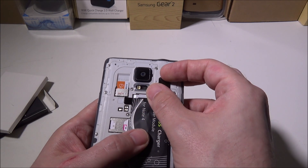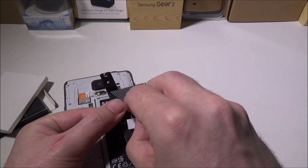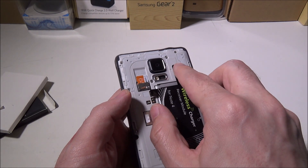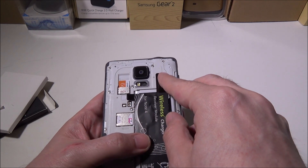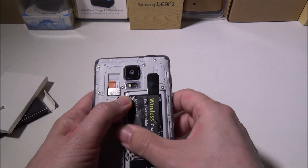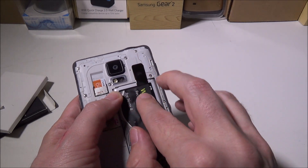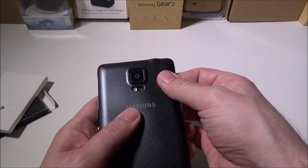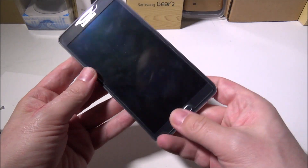There's a 5 volt pin here that will go in the top and impact these two pins as well. I'll take off the adhesive on the back, then line up the 5 volt pin directly with the battery so you're going in a straight line and the pins line right up. You can see the indentation of a single coil that will actually charge the battery and receive the signal. Once that's on and we're in the right place, we pop on the back cover.